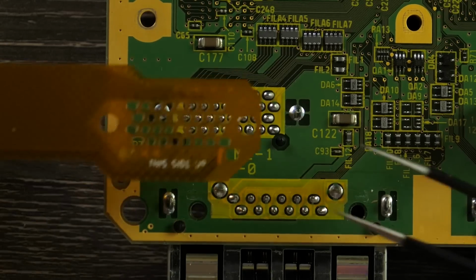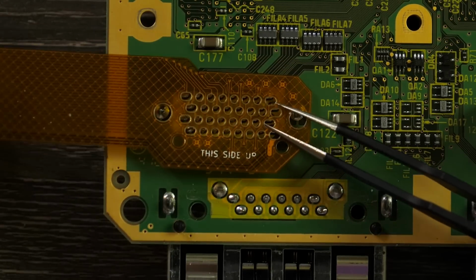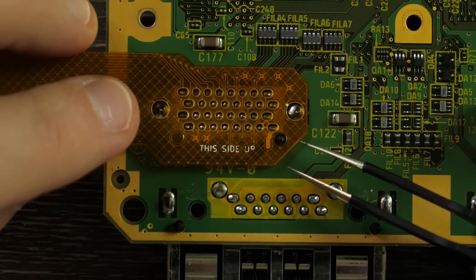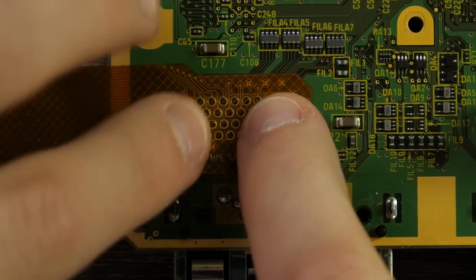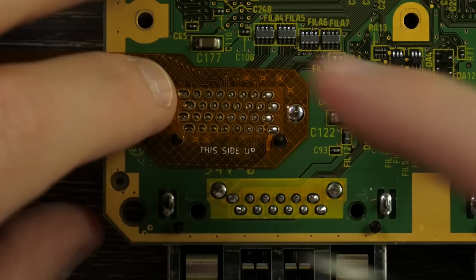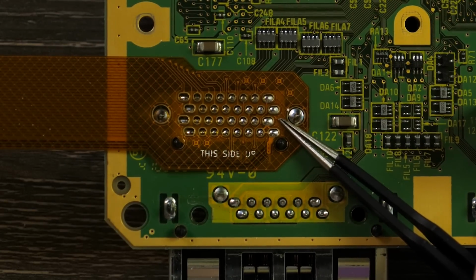So here's our cable, and it actually sits over those pins, and it's set up to line up very well with the ground pins, and we have some plastic guides here as well. But it's basically set up to pretty much just sit on there. So all these pins will go through, and then you actually solder it in. So we can see right there, it's sitting down, and it's ready to be soldered.